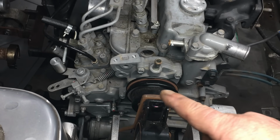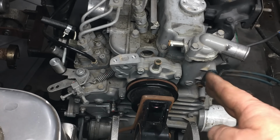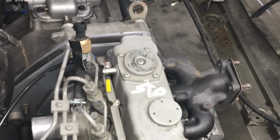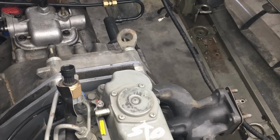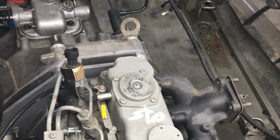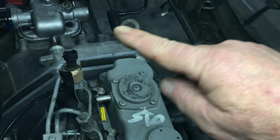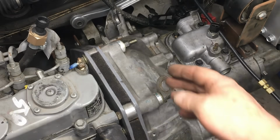So pretty much the whole front of the engine is unsuitable to anchor the motor mount brace because we need to keep the space clear of any clutter. And whatever bolts are available, well, they're too small. We need a good anchor point, and I think we're actually looking in the wrong area. So over here on the back side of the transmission bell housing, we have some beefy fasteners available. But they're too far away. Or are they? Let's take a better look.